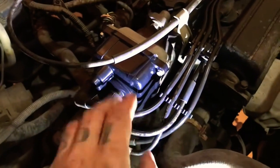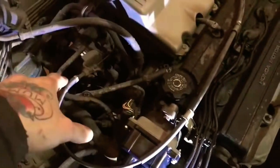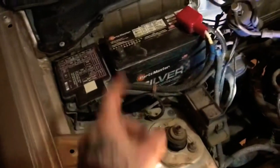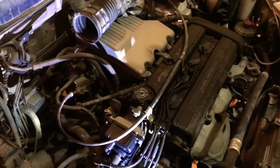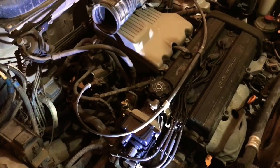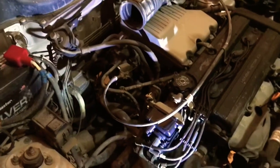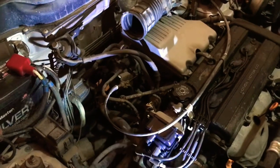And there you go — simple as that. Brand new plug wires. Brand new cap and rotor. Ready to rock and roll — along with the brand new spark plugs if you watched the previous video. Just button it all up: put the air box back in, put the air inlet back in, make sure you put your throttle cable back in the little bracket, and pop the negative back on. You should notice a substantial amount of power compared to what it was before — better spark, better starting. Hope this helps somebody out there. Check out the other videos and subscribe. Until next time, cheers.